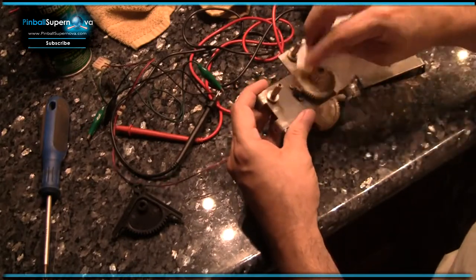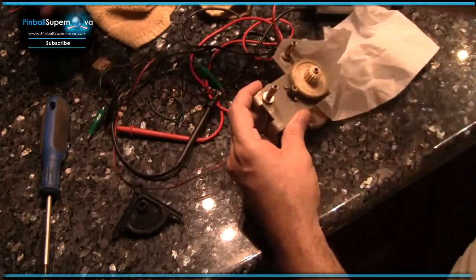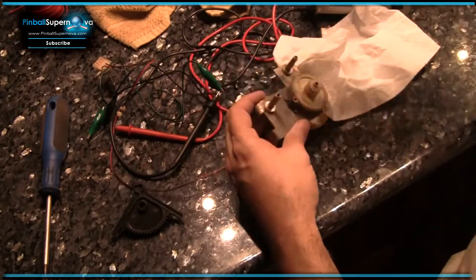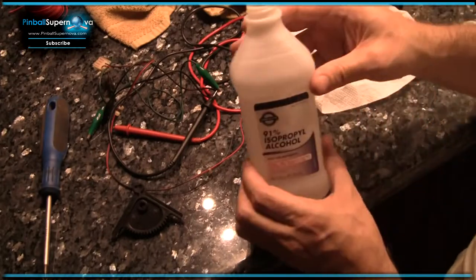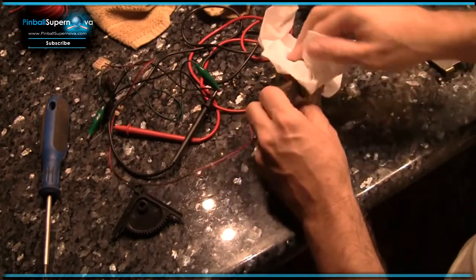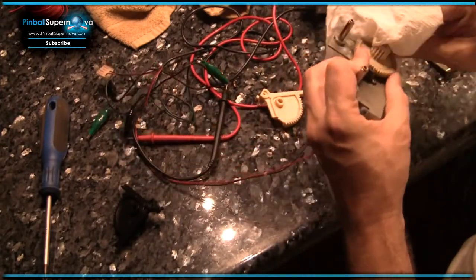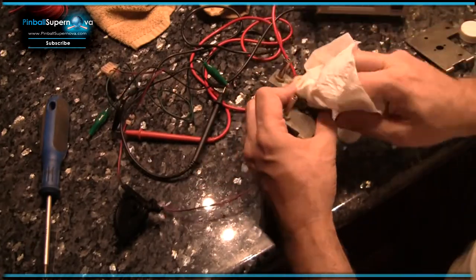There looks like there was a little bit of grease on this thing. I'm not a big fan of necessarily putting grease back here. I'm more inclined to use my old friend silicone lubricant. Spray it with this, and then wipe it down, and it's like a little protective film, but it's not otherwise sticky. But before I do that, I will take some alcohol and I will go over the metal parts with it and clean up a little bit here and there just to make sure that it's nice and smooth. So I'll go over all of that, clean these things up a little bit.